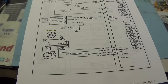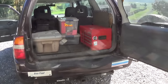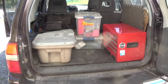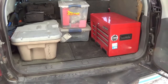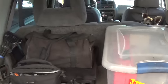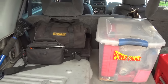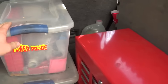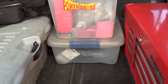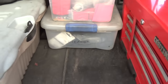Let's head over to Big Al's shop and do some testing. I've got the XL7 loaded up. A lot of you guys ask what I bring on a diagnostic call — that depends on what the call is about. In this case it's mostly electronic diagnosis. Got the portable toolbox, the DeWalt driver and drill for speeding things up, our electronics box with spare fuses, wires, soldering, circuit tester, fuel pressure gauge, stethoscope, and injector tester.